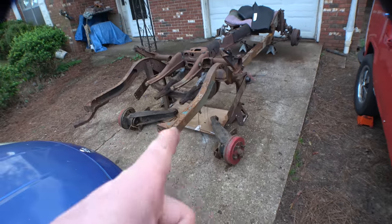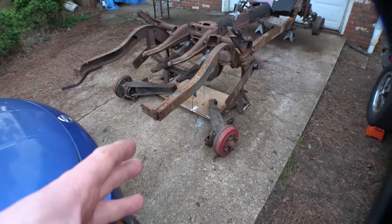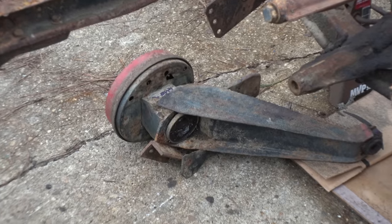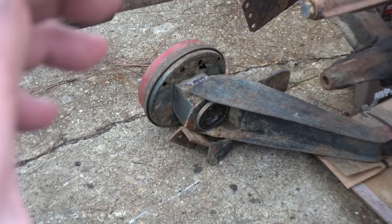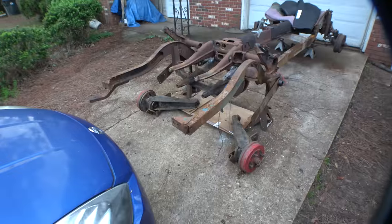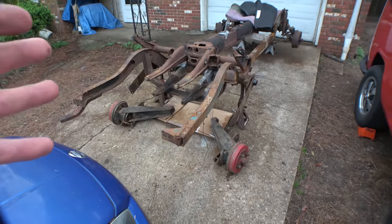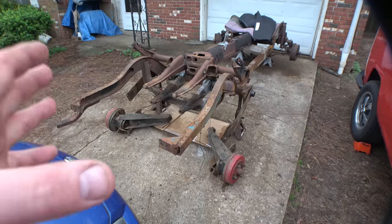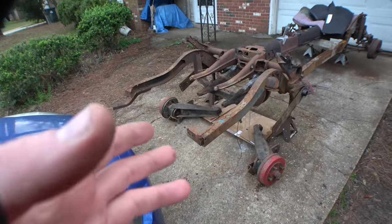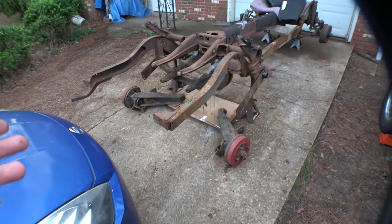These will be going up on this frame. The other thing I like about these is they also have the Thing axles in them, and I needed to order a set of those anyway. The beetle ones wouldn't suffice because the flanges on the backside here actually fit bus CV joints — the big CV joints, I think they're 100 millimeter — as opposed to the beetle ones which are a little bit smaller, like 90 millimeter. Big advantage: the bus ones are bigger, tougher, and they articulate more. The Thing trailing arms already had them, which is nice. So that saves me like $200 on top of purchasing these arms.